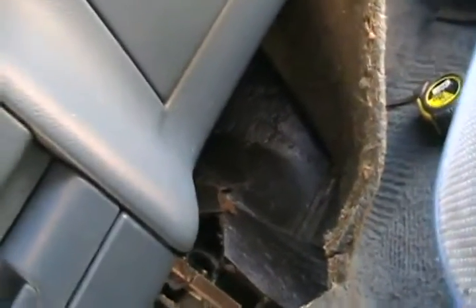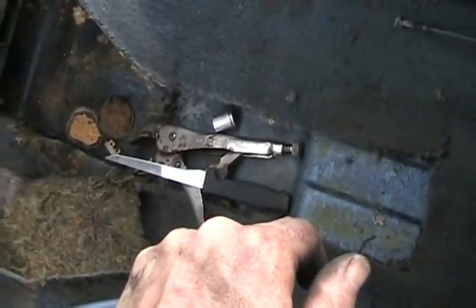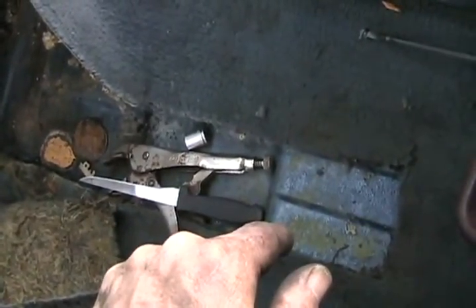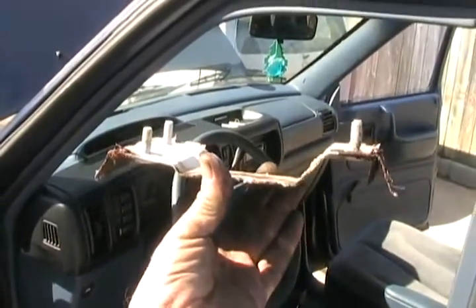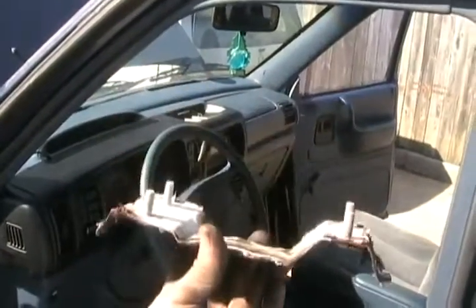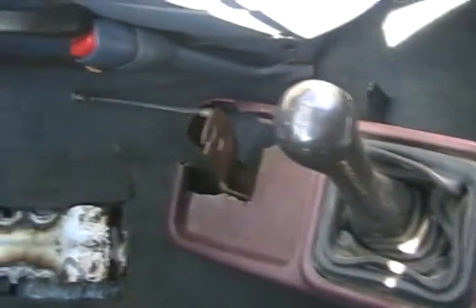I have cut a hole in my floor mat and a hole there for the shift cable to go through, and another hole way over there for the shift cable on the other side. There is that little plate on the other car that holds the shifter mechanism — I took it off because it lifts the shifter mechanism up a little bit higher, so I'll weld it on to make it work. As you can see, it raises the shifter mechanism an inch, so it'll still feel comfortable when I'm driving — it won't be sitting too low if I weld it directly to the floor. That'll go right there and then it'll all get covered up by the shifter mechanism.